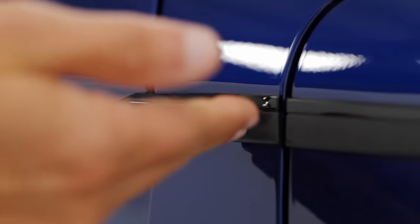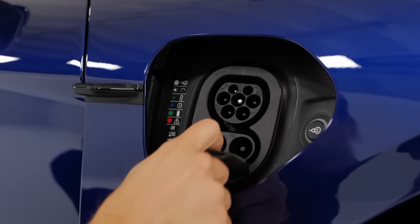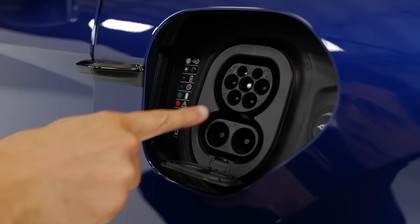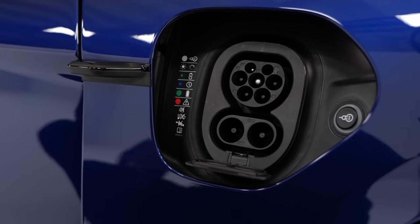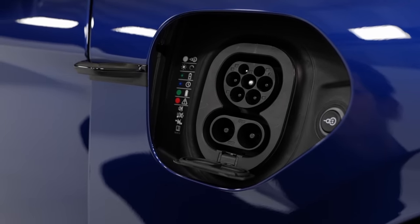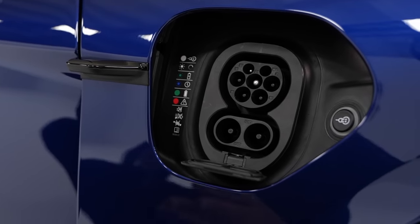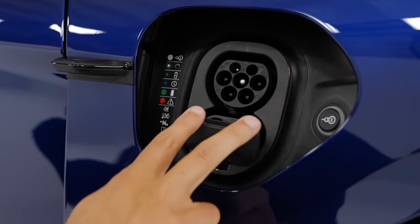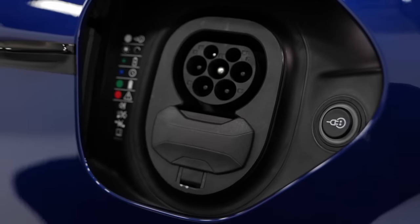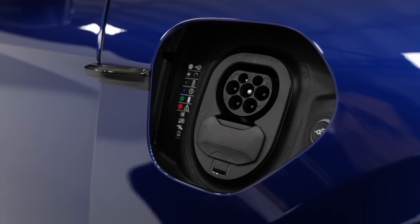And talking about all the charging data and so on, this one here, the right side now for the DC charging. So 11 kilowatt AC charging would be the top one, and then DC charging has a peak of 270 kilowatt. That's of course pretty massive. For this 93 kilowatt hour battery, that's size-wise also comparable to the biggest ones you can get in Tesla. Very interesting, definitely here. And again, you would get it on the other side than in the UK model. And what's also interesting with this car here is it has an 800 volt architecture, whereas most other EVs run on about 400 volt.